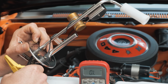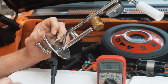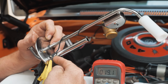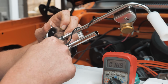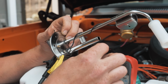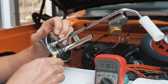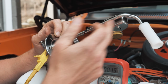And then, of course, your feed wire or your sending unit wire, we already talked about that, but I guess one last one would be sending unit wire to ground. We don't want to have, well, let me think about that. Yeah, we can't really do that test to check for a short to ground through the housing. So I kind of messed up on that, realizing the circuit design here, I can't isolate the ground. So to check this insulation area from here to here, what I was telling you guys is inaccurate, because whether I go here or to the ground stud, it makes no difference. I'm going to be reading through the resistor of the sending unit.